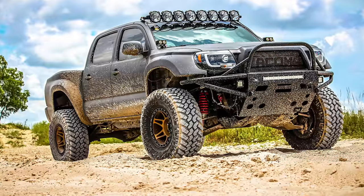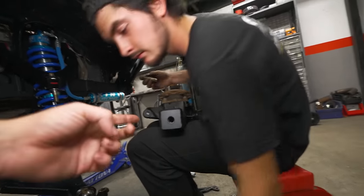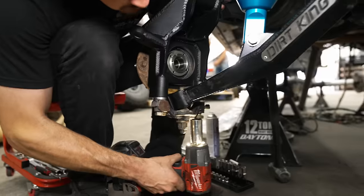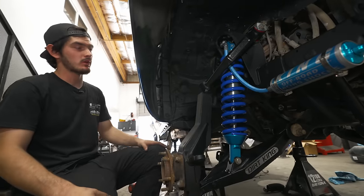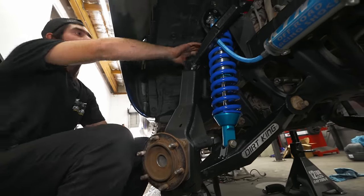This long travel kit - the same exact one Ian is holding right now - is actually the one that was on my second gen Tacoma before we stripped it. You definitely want a beefed up spindle because most likely you're going to be rocking 35-inch tires, a much beefier setup - spindles are usually what tend to bend when you're out on the trails. I'm going to torque the lowers to 140 foot-pounds, the upper one is 120 foot-pounds, and the other upper is also 120 foot-pounds.